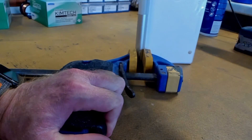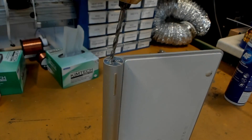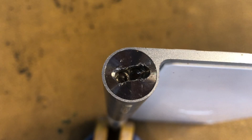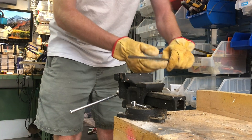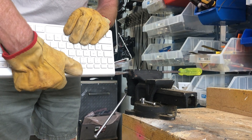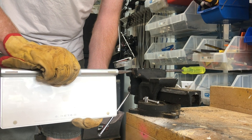If the coin is not cutting the mustard, you will have to use the destructive method — this may damage your keyboard. Place the keyboard in a clamp with soft jaws, clamping only around the barrel. Drill out both ends of the slot and the middle with a 3mm or 1/8 inch drill bit. Create a nice deep slot, then put a big flat screwdriver into a vice, put on protective gloves, and turn with a heap of force to remove the cap. Do not use your fingers.